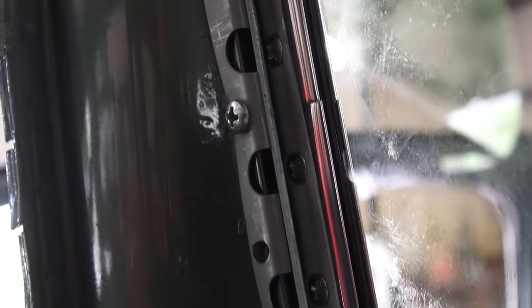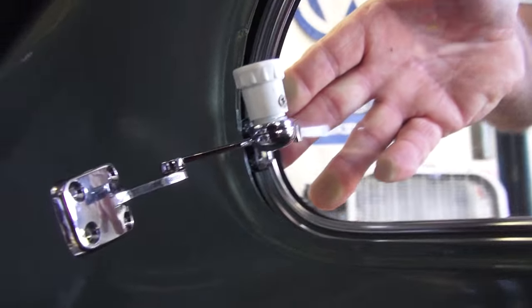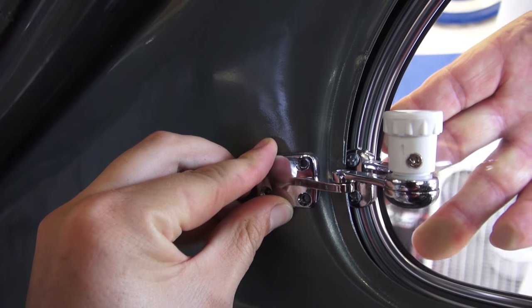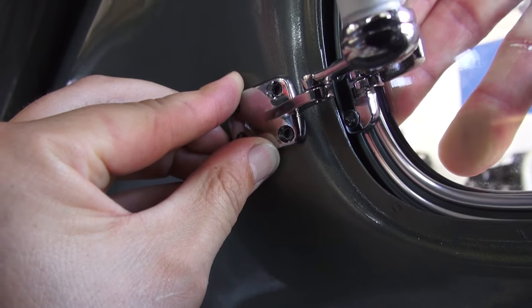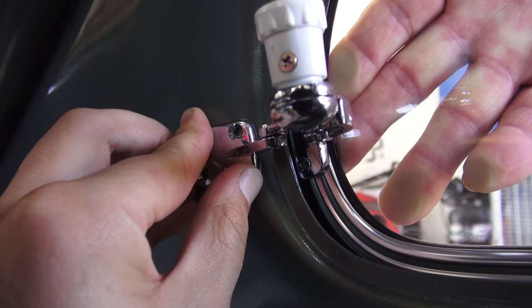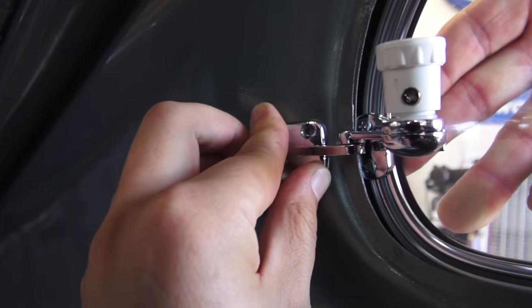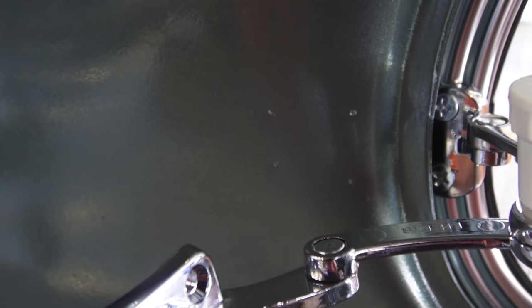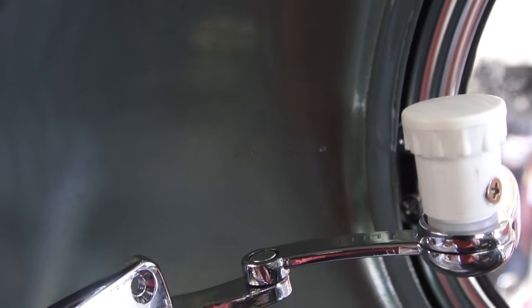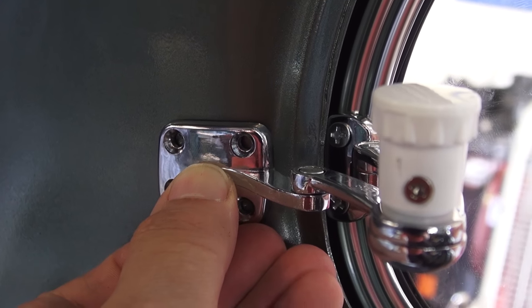As you can see, it's nice and tight with good fitment — and there are your holes drilled. Now the back latch area is a little tricky. You've got to set this up correctly — about an eighth of an inch from the first line you see, not the lip. Make sure that latch sits flush with the body and is even up and down — not too high or too low. I did some starter dimples with my punch. Test fit it one more time — this is crucial.